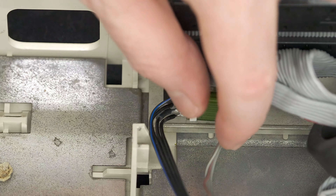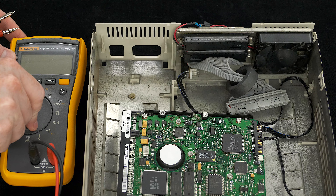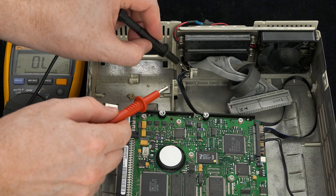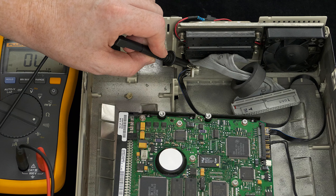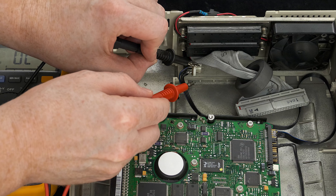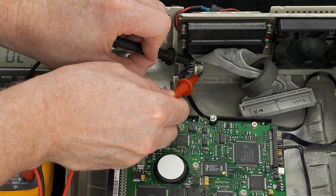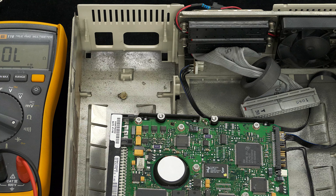Because these pins on the back just go straight through, I put my four wires and connected one wire to each pin, since we're not able to use the stock connector. I set my digital multimeter to continuity — meaning when you touch both probes you get a beep — then checked each pin. The topmost pin is spaced farther apart because it's the common pin. I changed the SCSI ID to 1 and found that pin one connects to the bottom pin.